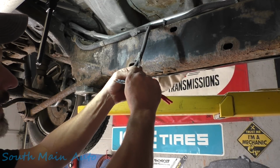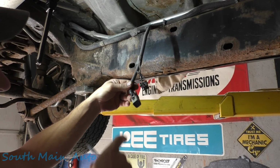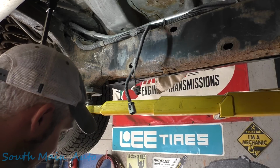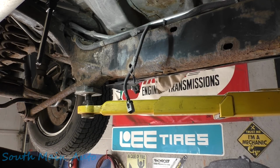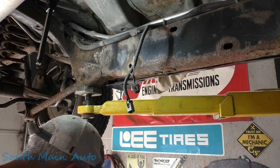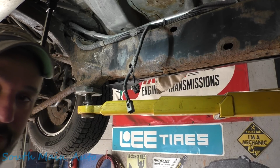We're not worried about the fuel tank pressure sensor. There's no problems with that, but we can confidently say it needs a fuel pump. And now we can tear into it and see what kind of rigmarole is going on in there. Because if I remember correctly, this guy had quite a history of fuel pump replacements.